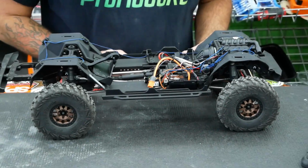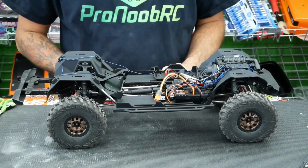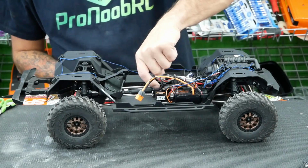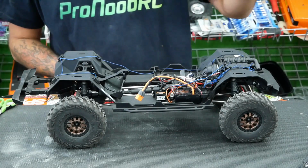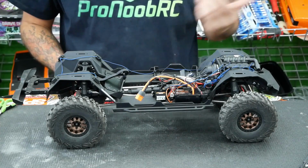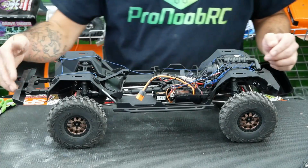They should have had an endpoint adjustment for that servo with their radio when they came out with the unit, or had that set up a little bit better. If you take it off and you move it over 1 tooth and put it back on, it doesn't go all the way into gear. So it's either mashing it forward, burns out the servo, or else you're not in gear. So you gotta find the happy medium, back those off a little bit, and rock and roll. Truck.